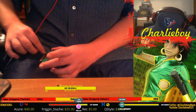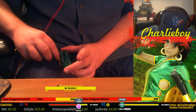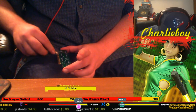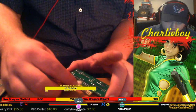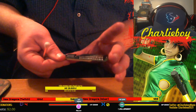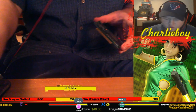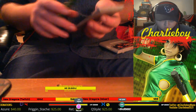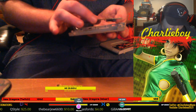But, yeah, okay. So we're going to finish this right here, cleaning the pins with the alcohol. I'm gonna take the dry side and kind of go over them a bit. Make sure they're nice and clean, about the best I can get them. And we'll put the cartridge back together. We'll plug up the SNES and we'll see if this thing works. Who knows? I might do a speedrun right after that. And why buy it if you can't do anything with it, right?